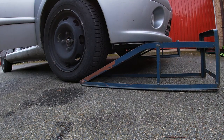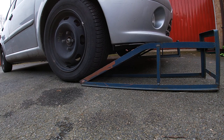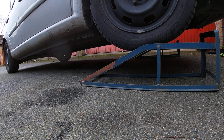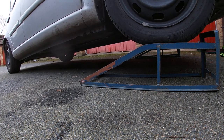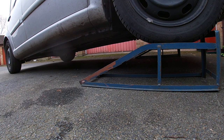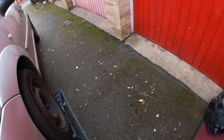Basically all I've done is a filter on this one, because with high-mileage oils what I do is just change the filter, then do a filter and oil change, then filter again, then filter and oil again. I'm going to have a quick look underneath to make sure she's not leaking. I don't like these ramps specifically — they tip — but I'll get it central. I never trust anything, so I'll come out and check the handbrake is on; the vehicle should really be chocked as well, even though the handbrake is just past MOT.